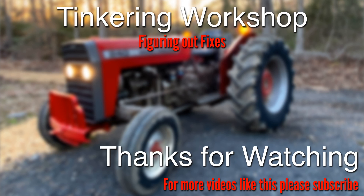Here's where the issue was coming from - this purple line has been severed at some point and they just tried to use electrical tape to hold everything together, which is crazy. There was a connector there but it just wasn't crimped very well. That's definitely an issue. And the connector here - again not crimped properly on this either. So we're going to go ahead and get this connected back together properly.